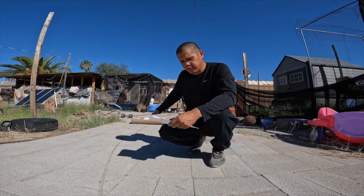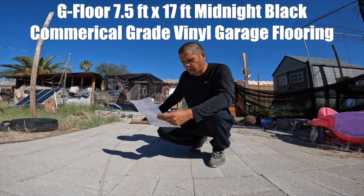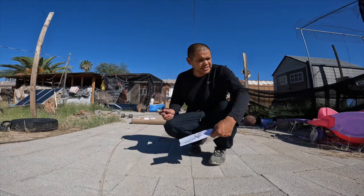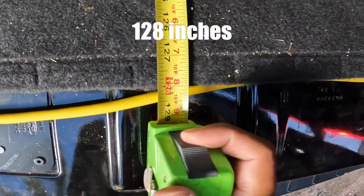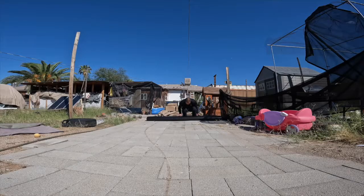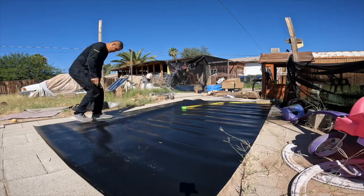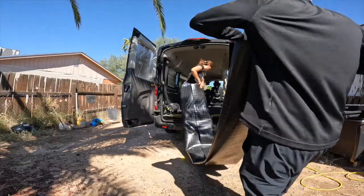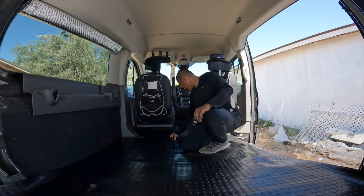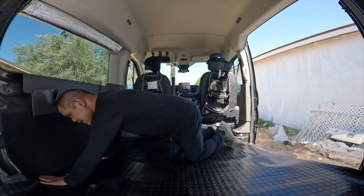I bought this coin flooring from Home Depot. It is seven and a half feet by 17 feet, midnight black, commercial grade vinyl garage flooring. I think it was like 300 bucks. I'm going to go measure and cut this thing up. The van length comes out to 128 inches, and width-wise the van is 68 inches. I got a little screw — I'm going to screw this coin matting down to the carpet. I just have to make sure I don't drill through the heater. That's to prevent the coin mat from shifting. I got it nice and tight against this wall.